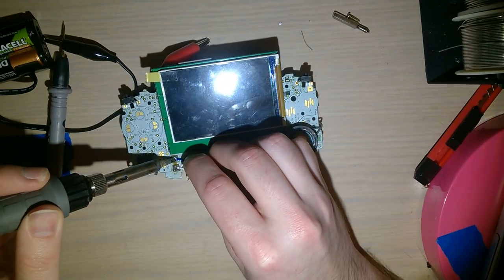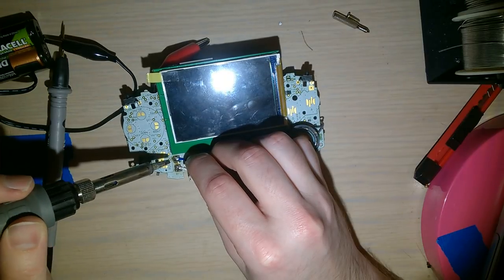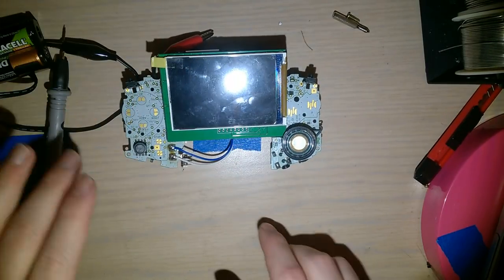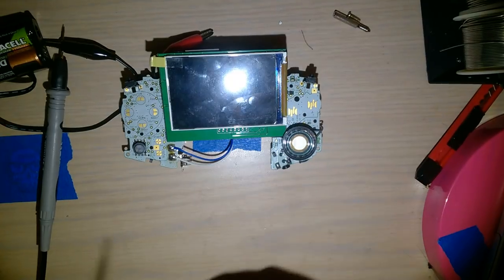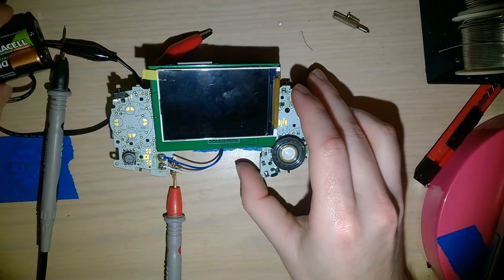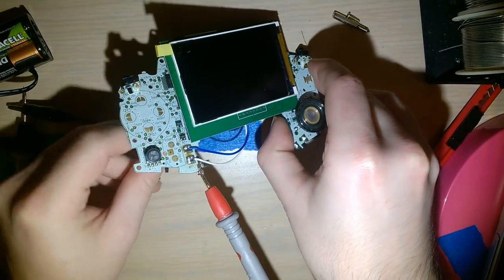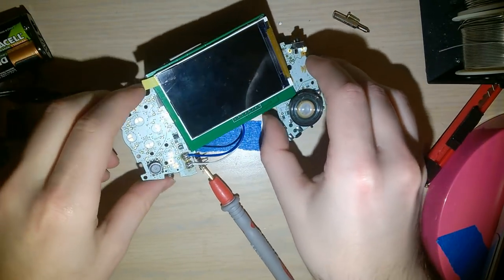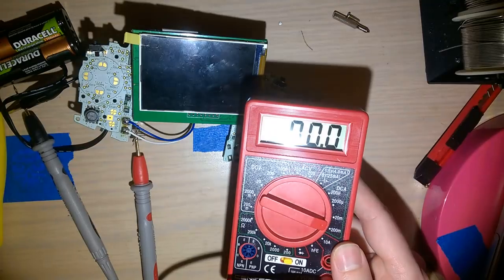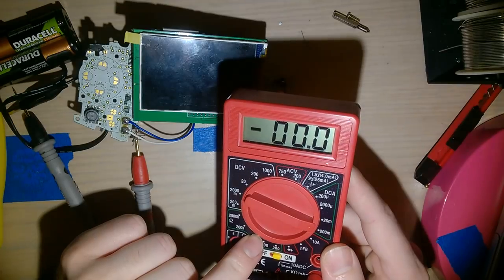That in there. Now when I saw that you have to wire, or at least that the guide I'm following wired it straight to the battery, I was kind of concerned that this would lead to some transient voltage drain, but that's not quite the case. Okay, so gotta plug it in. That should be fine hanging like that. It's gonna sit at a little bit of an angle. But you can see it's plugged in, it's off, but per the meter, it's not drawing anything.